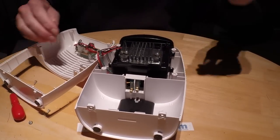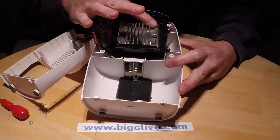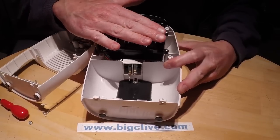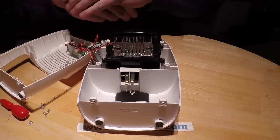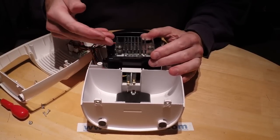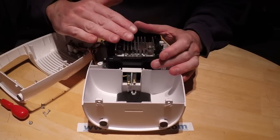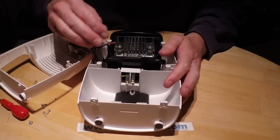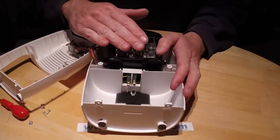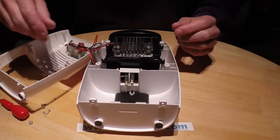The first thing I'm seeing here is an aluminium heat sink with a smooth finish - I'm guessing the Peltier junction is sandwiched in here. There's quite a lot of condensation on this, so it's obviously the cold side that's collecting the water. The principle is that air holds a certain amount of moisture according to its temperature, and when warm moist air hits a cold surface it condenses. So what they're doing here is pulling air past a cold fin so any moisture in the air hopefully condenses on it.